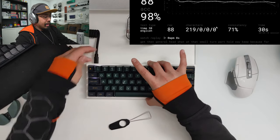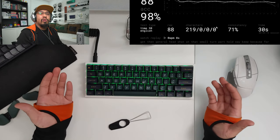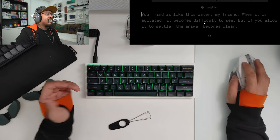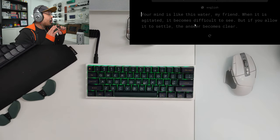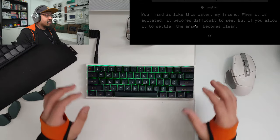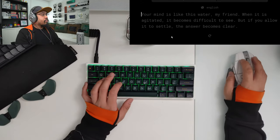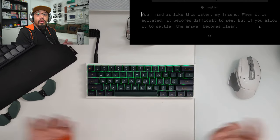And I found that with a lot of gaming keyboards, the sound of the board happens to be affected a lot by the switches that are on them. And I noticed the old ones are not lubed. If they were lubed and had tape mod, they would sound much, much better. A lot of the newer keyboards, especially from ROG apparently, have both a tape mod and foam inserts. Ducky is also a gaming brand, and their three versions of this exact same keyboard actually have filters or foam bits in between that make them sound solid. They don't sound like a reverby mess, and they don't sound plasticky in comparison. They still sound somewhat plasticky, just a more solid plastic. All right, but let's go into the quote. Let's type out the quote.